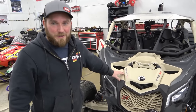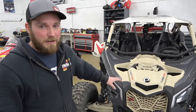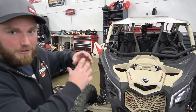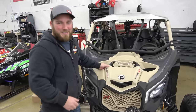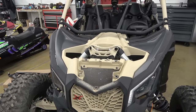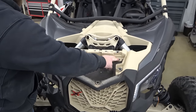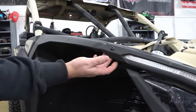What's not easy is taking the front end off an X3. They're built kind of weird, and if you try to take each individual piece off you're gonna have a bad time. The goal is to take the whole hood and everything off as one piece. First things first, the hood just pops off - that's probably the easiest thing. Behind here you've got two T-30s that have to come out, and then on either side you've got a T-30 with a 10 millimeter nut on the back side.